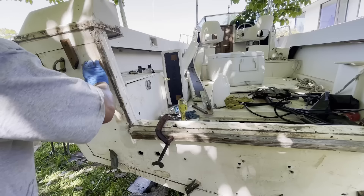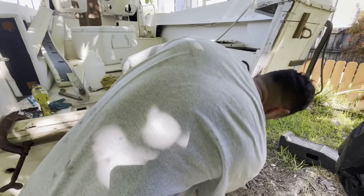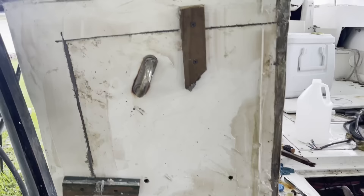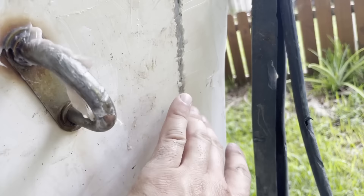It's a little messy but I've got to come back and sand all this. The next day this stuff is cured. Now I'm going to go in about two inches off each side, grind that out, and put some layers of 1708 and chop strand mat just to hold this all together a little stronger. Let's take these guys off and do that.